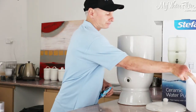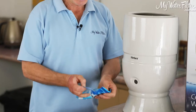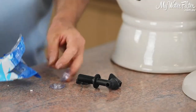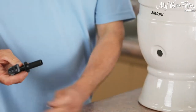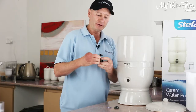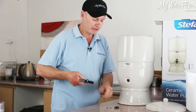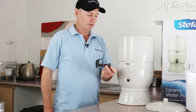So the first part here is our tap. These systems here just have the one filter in them, so we'll get the tap on the bottom first. Very similar to any other of the Stefani gravity water filter taps — get your rubber washer, your O-ring, and fit that on there first, hard up against the backing plate of the tap, to give it a bit of screw on the thread, so you can get it nice and square and straight. Then we'll put the second washer on and the nut from the inside, and we'll seal it on like so.